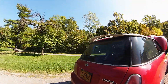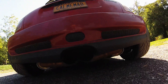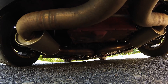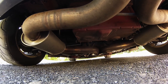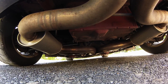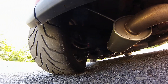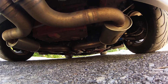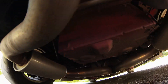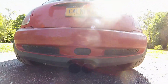Exhaust is still exactly the same. My flex pipe is leaking again — I've got the Megan header and those flex pipes always break. We cut it out and replaced it with a Vibrant flex section and made it a little bit lower on the exhaust so it didn't move as much, but it still ripped after one summer so we're going to have to come up with something else. Still the two-and-a-half inch test pipe from Filthy Habits, two-and-a-half inch straight midsection, splitting into a two-and-a-half inch double resonated section — all built by Jason at Filthy Habits Fabrication. Sounds awesome, welds are great, top-notch work.